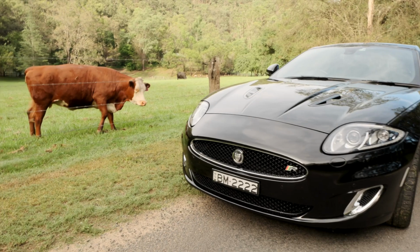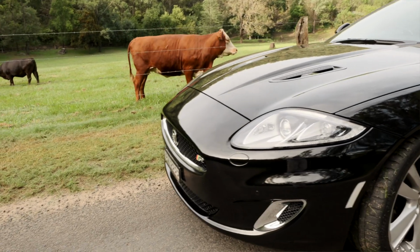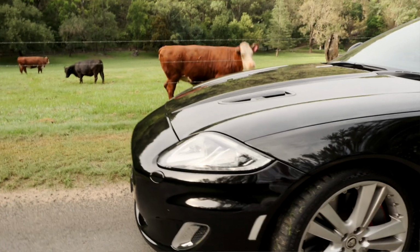Aluminium bodywork is expensive to fix by a specialist repairer. Also, special painting skills are required to avoid blistering and peeling. Also check that the plastic headlights are not cloudy. Again, this is something that can be done DIY, but it's a bargaining chip.